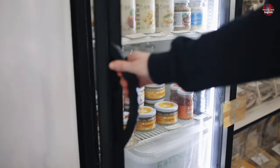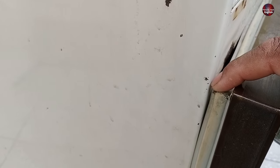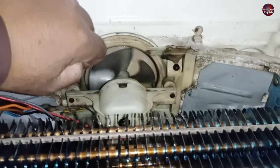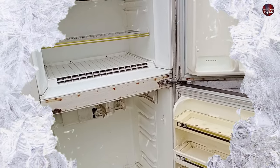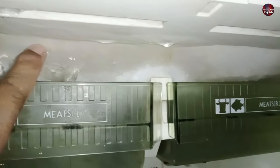This refrigerator door is not closing properly at all. You can see a gap between the fridge and the body. This is a no-frost fridge, and frost-free refrigerators cool with air circulation. Due to this gap, the air moisture goes inside the refrigerator, which affects the refrigerator's cooling, and ice is also shown on the evaporator of the fridge.